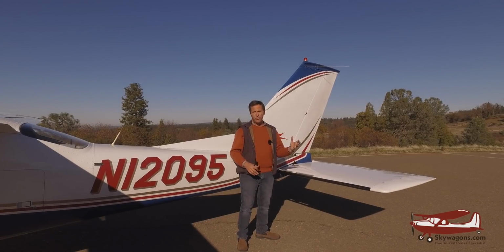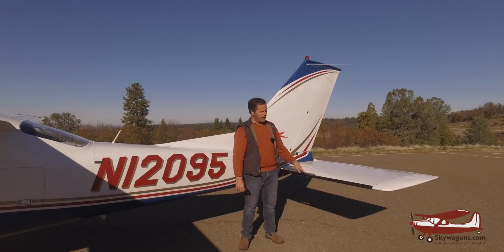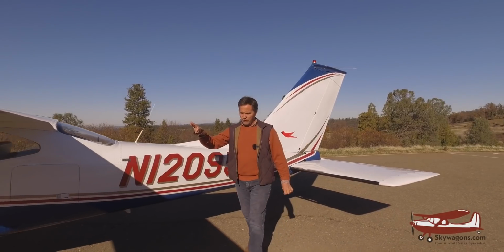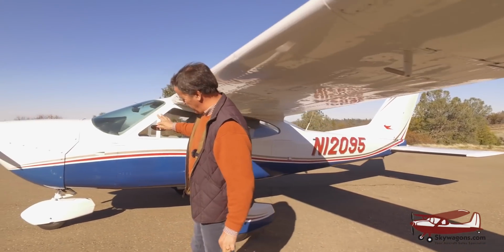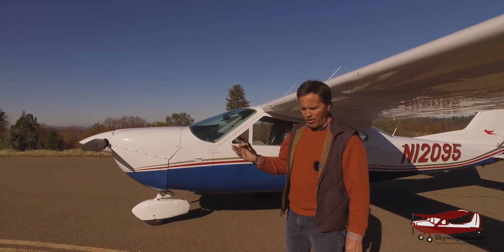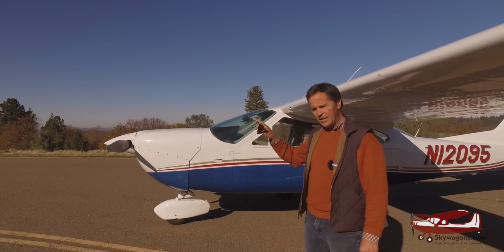And I was speaking to a very, very knowledgeable person called Keith Peterson, who founded the Cardinal Flyers Association. He's the most knowledgeable Cardinal guy in the world, literally. And if you need a pre-buy done on any Cardinal anywhere, he'll do it. But he was telling me these were added to the '68s. '69 got them. They went from 150 to 180 horsepower with the B model and with a constant speed prop on it. So this engine combo that's on the front of it is very similar to an Mooney M20C, in an early Piper Arrow. The RG version of this that came out in '77, '78, they were 200 horse injected Lycomings with constant speeds.